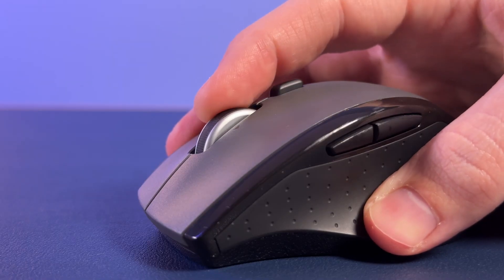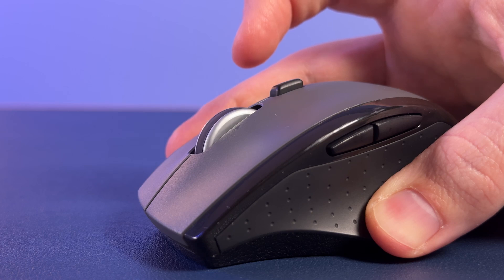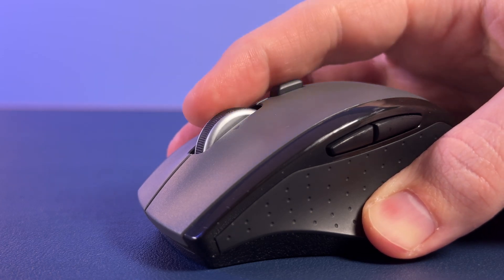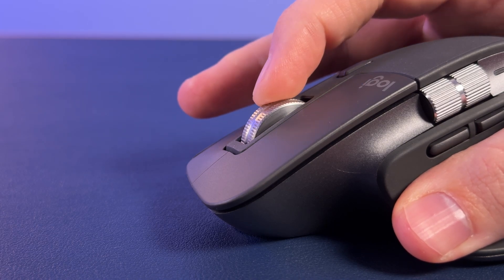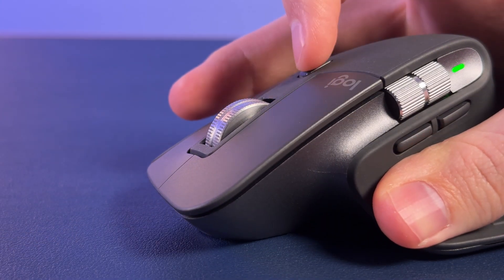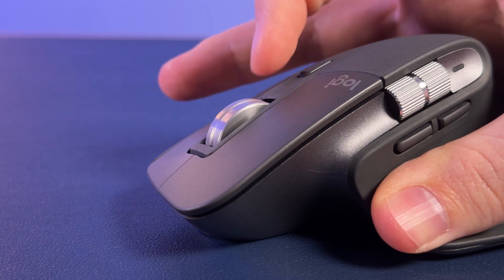In some cases, like with this Marathon mouse, this button is actually mechanically changing something internally in the mouse. You can even see the wheel move slightly when pressing the button. On some of the more advanced wheels, like the one on the MX Master, this button has a similar impact, but it's actually making an electronic change rather than a mechanical one. This is evidenced by the fact that the button engages hyper fast scrolling only when the mouse is powered on — with the power button off, the button doesn't have any impact.